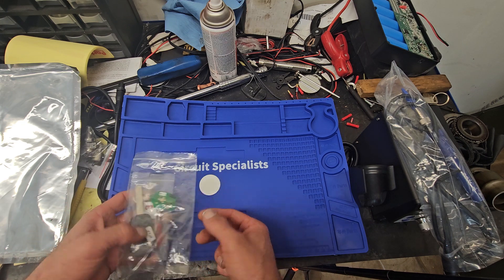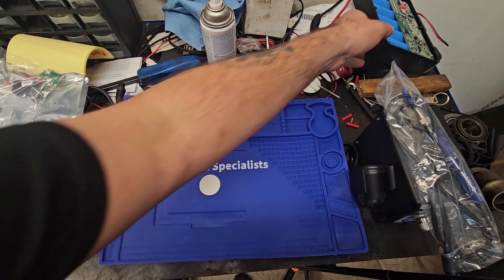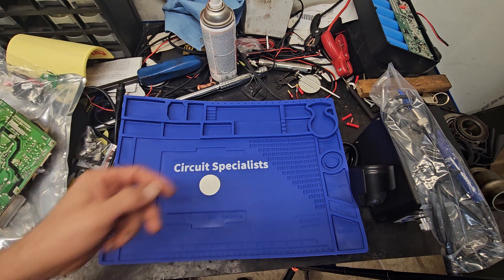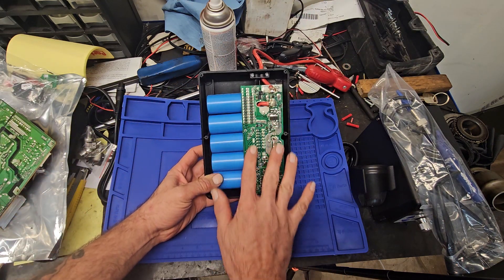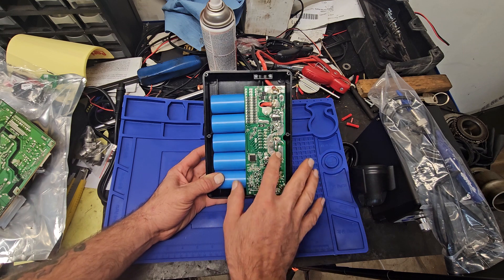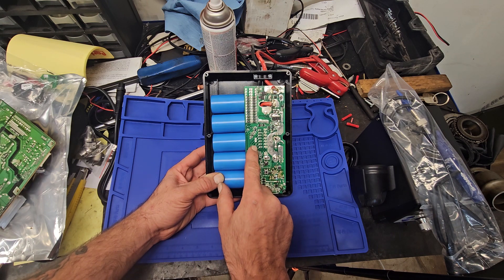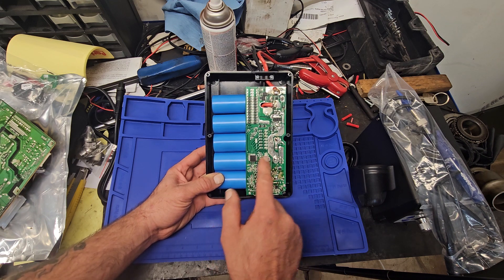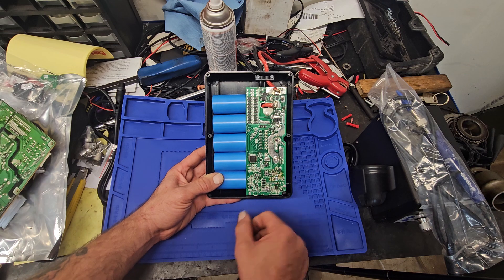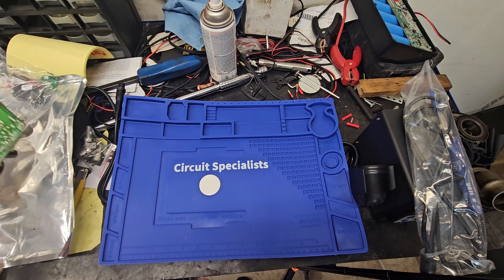Things like Chrysler and their TIPM — T-I-P-M — these things are constantly going bad. A lot of the symptoms are related to what's on that board. On those boards the TIPM will have a board that looks similar to this, and there'll be relays — a couple relays on the other side. The symptoms are very consistent with either those relays going bad or part of the control circuit going bad, which is not a terrible repair. With the right tools it's pretty simple to extract the bad component, install a known good, and have a piece ready to go.